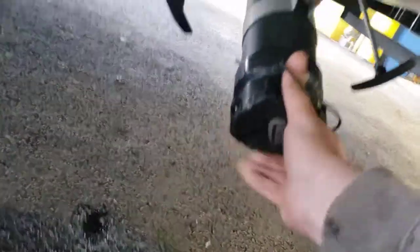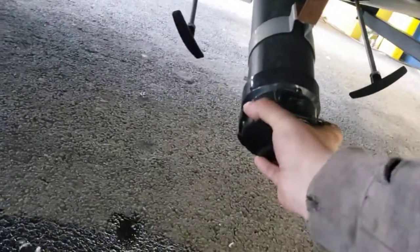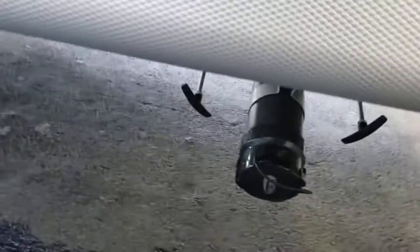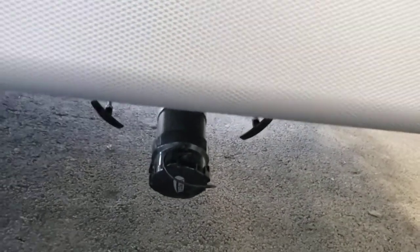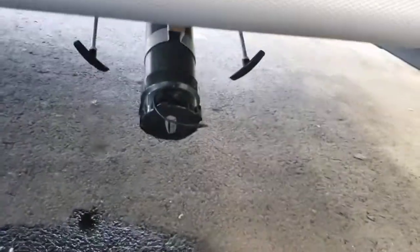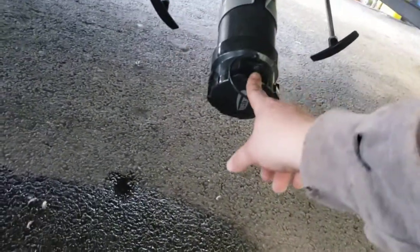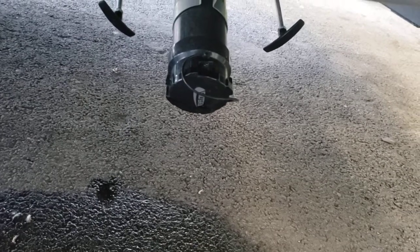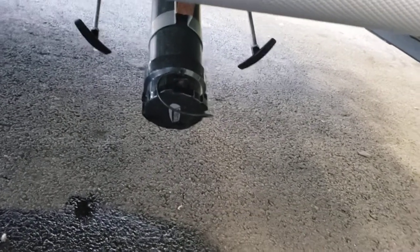Here are your gray and black tanks. Make sure the cap gets put back on. The one on the left is your gray tank; the one on the right is the black tank. The black tank is toilet water — gray water is everything else. There's a second gray tank up front for your kitchen sink. Always make sure those valves are closed before you take this cap off or you'll get a nasty bath. Dump the black tank first, then use the gray tank to flush out the hose so you don't have to carry a stinky hose.